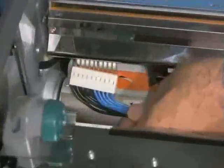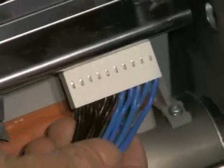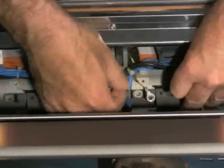Reattach the left and right power cables. The cables are pre-bent to match the correct orientation on the power supply head. Replace the power supply cable bracket carefully, making sure that the grounding clip remains on the top of the cable bracket.